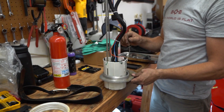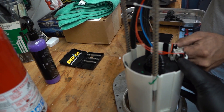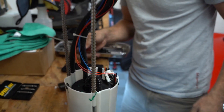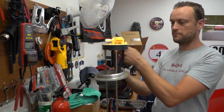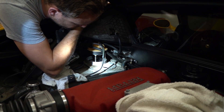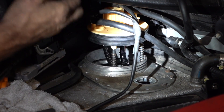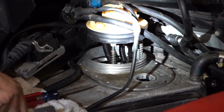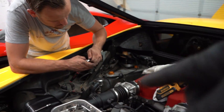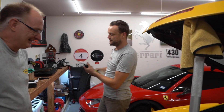This is going to be interesting, you gotta go around that - this might have to come off right there. Very very careful - there it is. Got it straight up. We're definitely going to need to put some lube on there and realign the gasket. This gasket for some reason is stretched slightly, so we're going to have to clamp it down on one side, push the gasket into place, then clamp it down on the other side. The ring popped out in the rear as we pushed it in the front - down to the last two bolts.